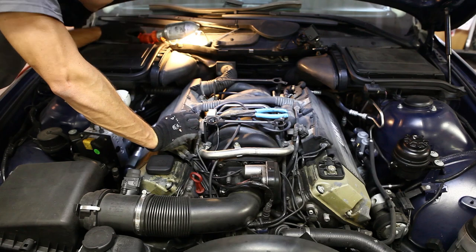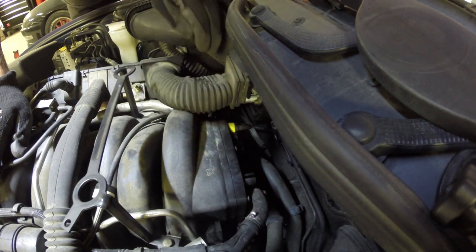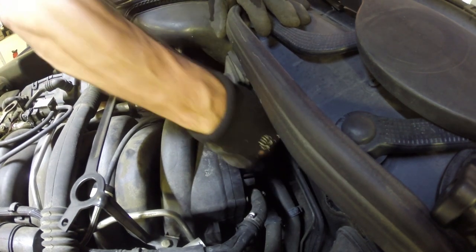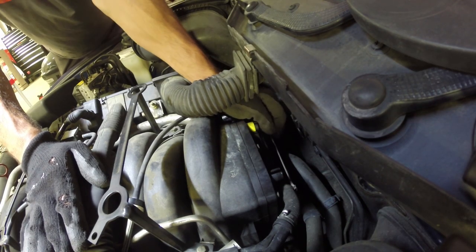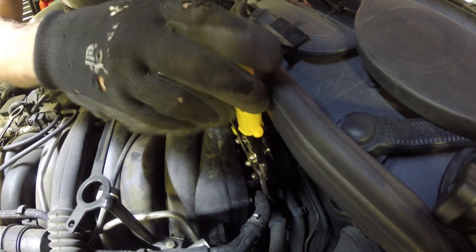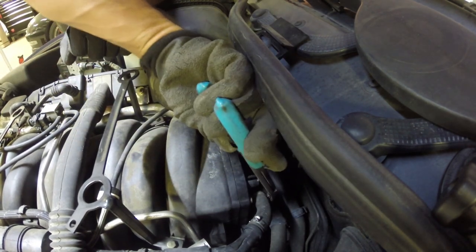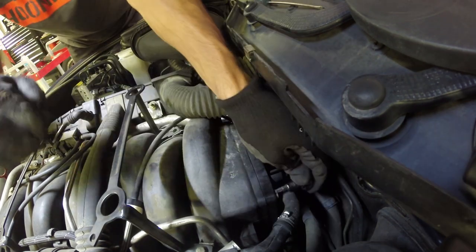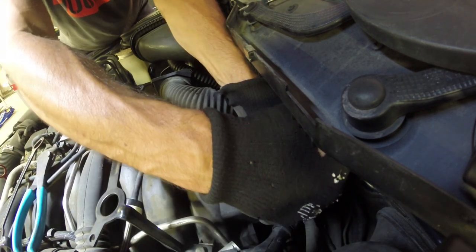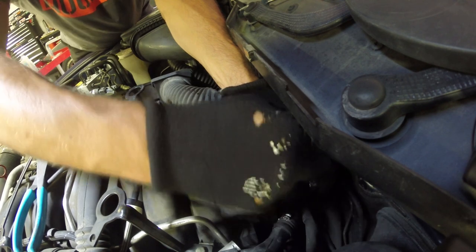To get started, you're going to need some light back there. Start by disconnecting any loose hoses you can get your hands on. The large crankcase vent hose is held in place with a crimped clamp. I tried various destructive methods with different tools to get it off but failed. The best method to remove this is after the valve is off the manifold, so leave it be for now. It's best to start with the easy-to-access Torx bolts — mine were incredibly hard to break loose, so be careful you don't strip them.